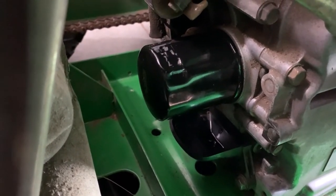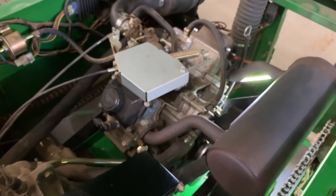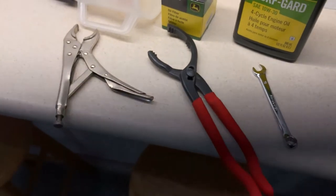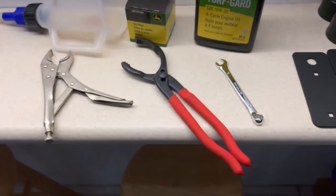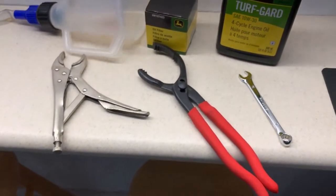It's all pretty slick and pretty clean if you place your pan properly, or use two pans. What I did was, prior to running the motor and getting it hot, I did a dry fit to make sure what wrench I needed for the drain plug, and also used an oil filter wrench — about $10 at Fleet Farm or Amazon — to loosen up that oil filter. 10 millimeter is the size for that petcock.